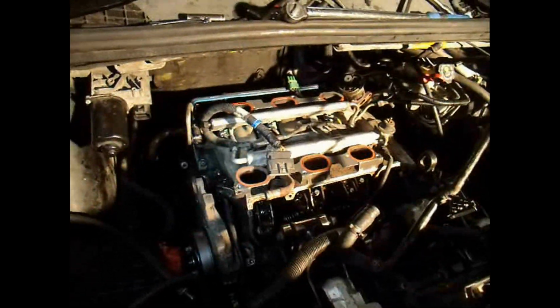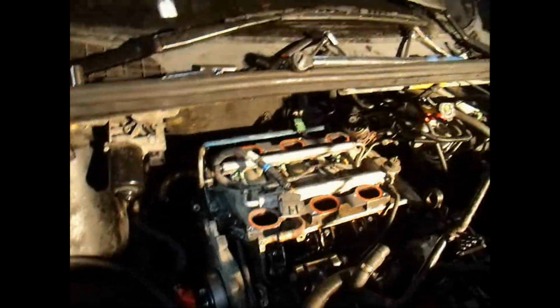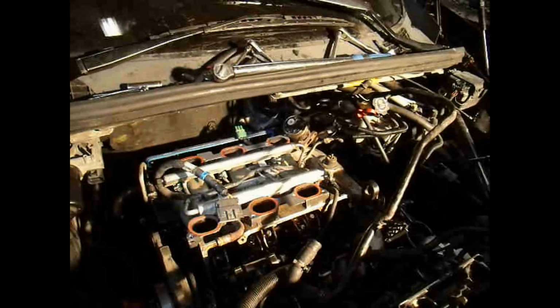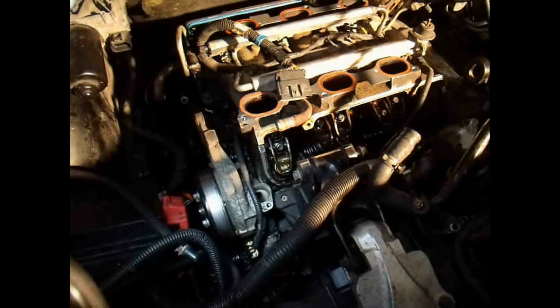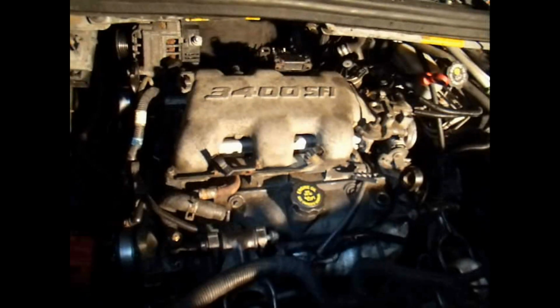Gonna put these valve covers on there, then I'm gonna put the bracket on there, and try and get my upper intake bolted on, and some of these hoses for the water pump there, this pipe here. So next step, valve cover gaskets, then that bracket, remember.